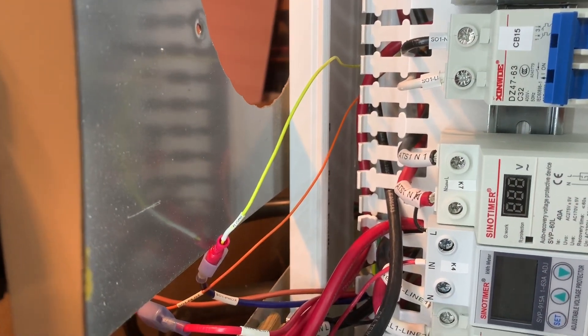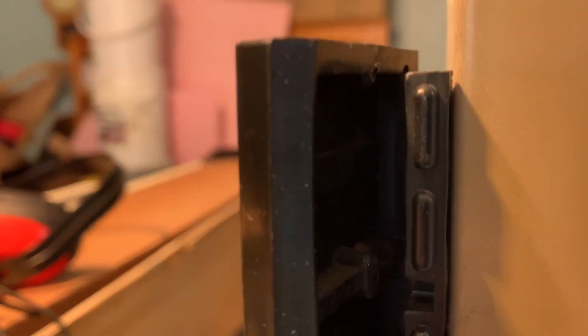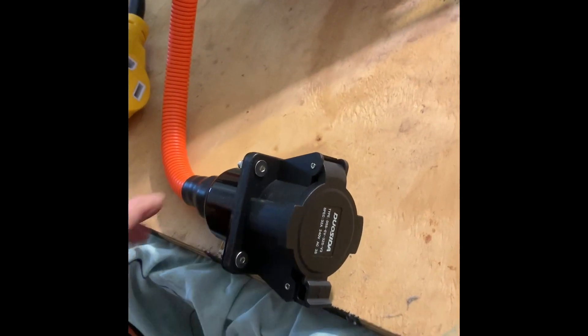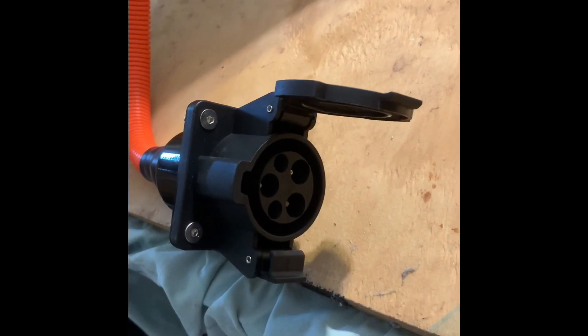The yellow and orange wire represent the proximity and the pilot signals coming from the EV charging system. Here's the EV charging cable I bought from China off of AliExpress with a three-foot pigtail on it. It's like any EV charging system — J1772 — and it runs into the back of my electronics box.